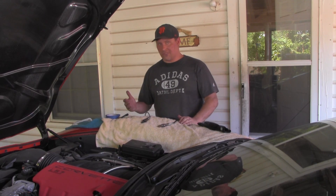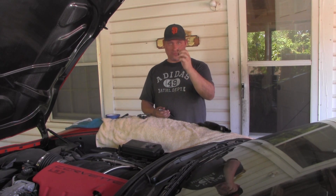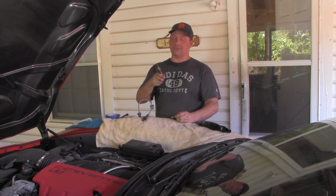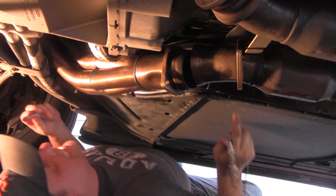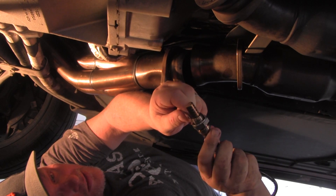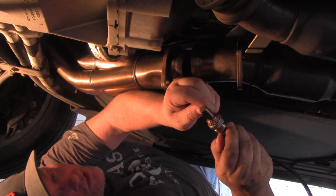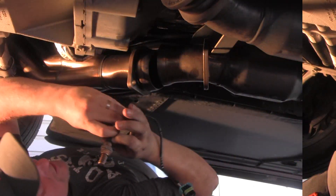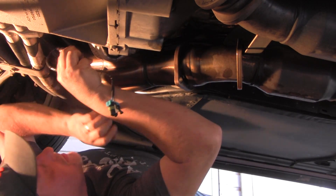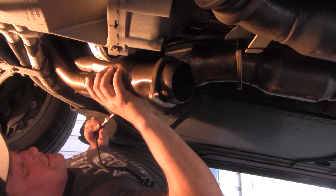Well, it took a few hours and a couple extra steps, but I got the O2 sensor off the car — it's pretty shot. I got a replacement here, along with a little copper anti-seize packet. Before you put it on, you've got to take that copper packet and put it all the way around the sensor threads so it seals correctly when you screw it in. That way you get a good seal. I'm going to reach up and see if I can feed this in — this ought to be good.